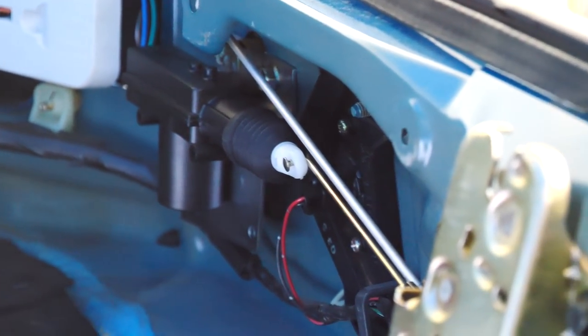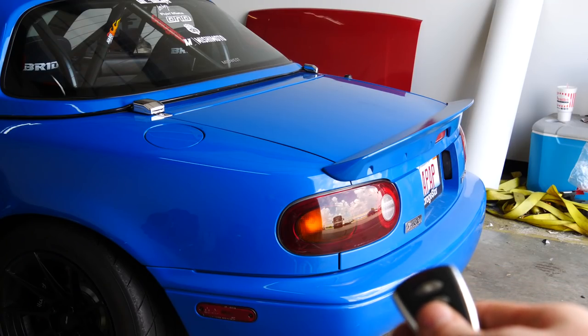The motor is now in. The trunk button works — you hold it down for a couple of seconds and it pops open, exactly how we wanted it. This central locking system has another really cool feature where it will flash the lights: hit lock and the lights flash once, unlock and they flash twice, trunk button and they flash three times. It took me three tries to find the right wire — it's a red wire with a black stripe, essentially the power wire for the daytime running lights. I wired it up into the license plate light wire because that was the easiest to find, and now you hit the button and all the daytime running lights flash.